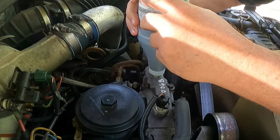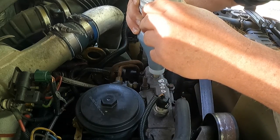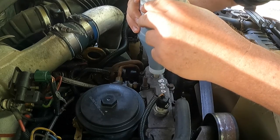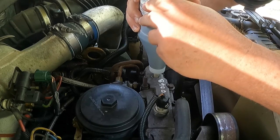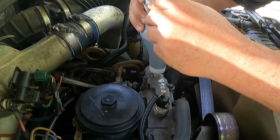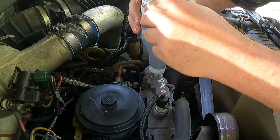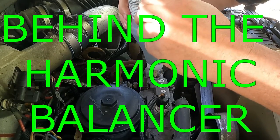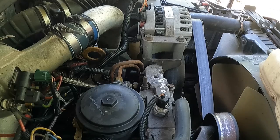And this opens up a debate that people have on some of these tech pages of changing the oil. Some people want to suck the oil out of this. Now, granted, there could be some cases where people have not been changing their oil regularly and they got a lot of sludgy stuff, and there could be some benefit to that. But if you don't know how the inner workings of the 7.3 are, there's a low pressure oil pump behind the crankshaft that pumps oil through the motor just in a traditional way, getting the mains and all the valve areas and all of that done.